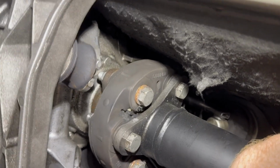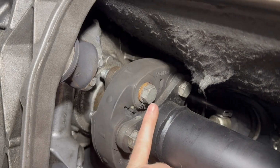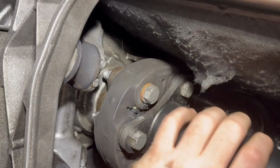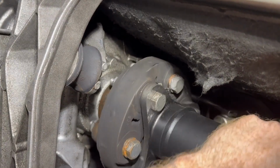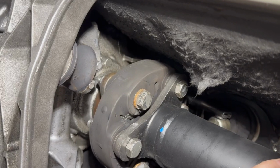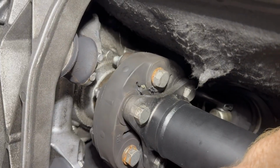This really kind of shocked me that this thing was able to move. You're talking about at least the end knuckle of my pinky of movement, which means that when this thing starts to go, whether it's during clutch kicks or when it really loads up, it's still twisting, but this is compressing into this. So let's throw the new guibo that we have on it so we can at least fix the problem for now. But we're definitely going to do some research and try to figure out what we might be able to do as a more permanent option with some added reliability.